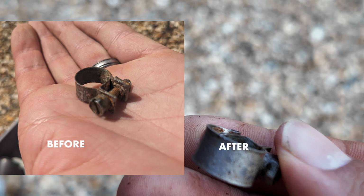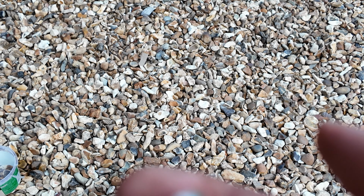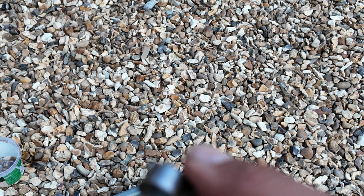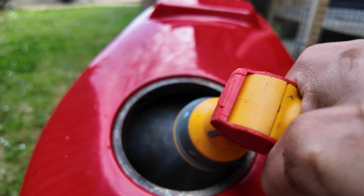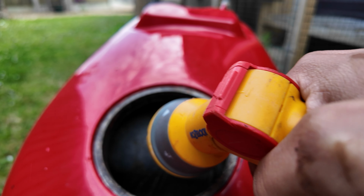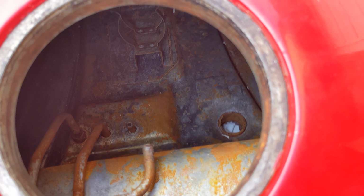There you go. It's smelly. It's not perfect, but it does work. After rinsing out the tank, you need to stick something in it to neutralise the acid and stop something known as flash rust. In my case, I used a solution of water and a few teaspoons of bicarbonate of soda, which I was a bit slow doing, so I ended up getting flash rust anyway.